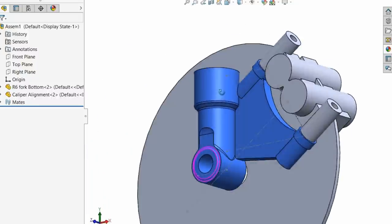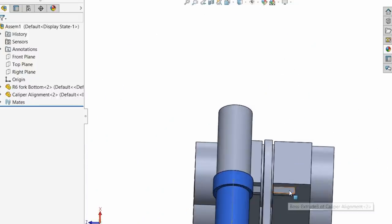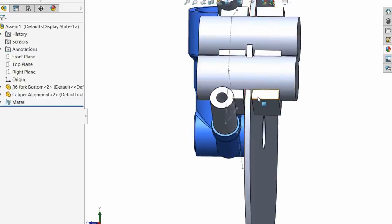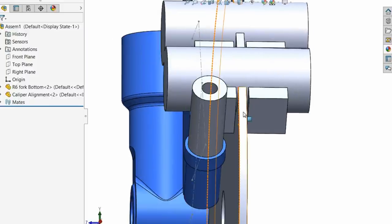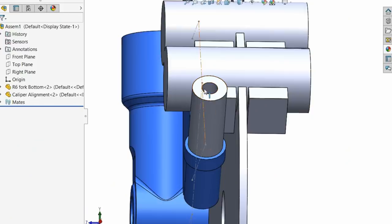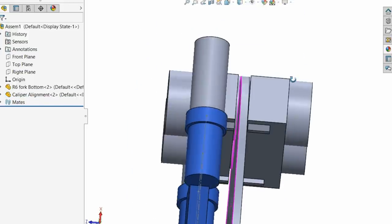And the caliper, again, it's just a mock-up. What I wanted to get in the caliper mock-up was I measured the center line of these holes to where the disc would fit. I put up a picture, and basically all I did is I jammed in loads of scales, basically rulers, just jammed them all in until the pads sat against the pistons. I used one of the scales in the middle and measured that against the edge of one of the dowels, and then measured the diameter of the dowel and halved that to get the center line of this. So that's approximately where the disc sits.